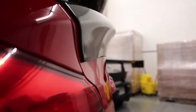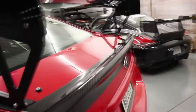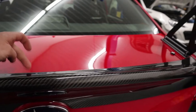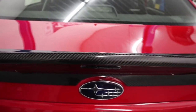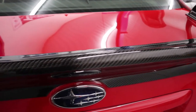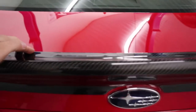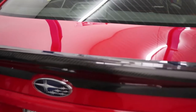It fits really well with the trunk as far as the body lines. Basically what we did was we laid multiple pieces of double-sided tape on the back of this guy, and then we pulled a few tabs all in the center — there were four tabs right here, here, and here. Then we basically laid it down, made sure that it all lined up with our painter's tape. As we got it very close to the trunk, we started pulling one tail at a time and pushing the spoiler down into the trunk to ensure that it adheres. And that resulted in the best fitment, ultimately.